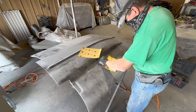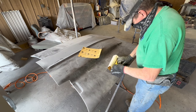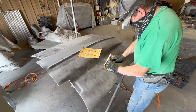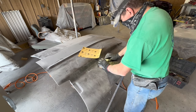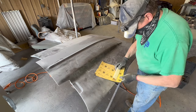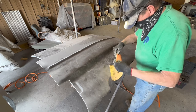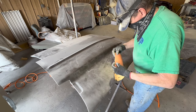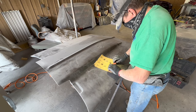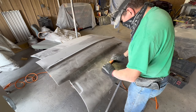Here I'm going to tighten up the sheet of 320 that I keep wrapped around my wider billy stick. You want to keep the paper tight around it, or else your stick can fly out from one side or the other. Although I smashed the paper down on the ends of the stick. The stick is 8 inches and the paper is 9, so I can smush it down on the ends to keep the stick from sliding out.